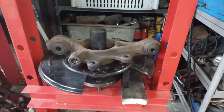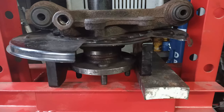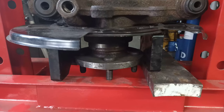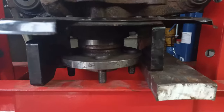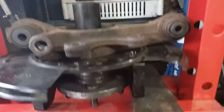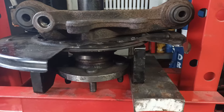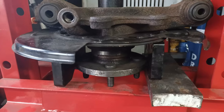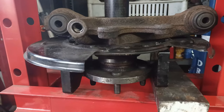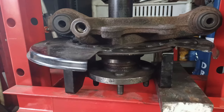I've got it on the press and I'm just pushing - you can see the bearing is just showing there now. The fact that I could push the bearing out without removing any clips means the clip would appear not to be there anymore - possibly it's been damaged, rusted through, or fallen out. Luckily I have a replacement circlip which I picked up just on the off chance it was going to be damaged. The bearing itself is coming out surprisingly easily, and that's obviously the reason the sensor was damaged - the whole bearing has managed to drift out slightly enough to cause it to rub on the casing of the prop shaft.